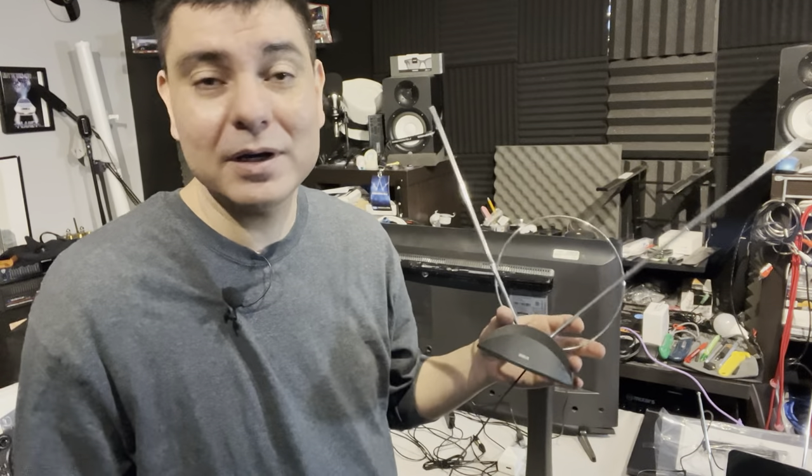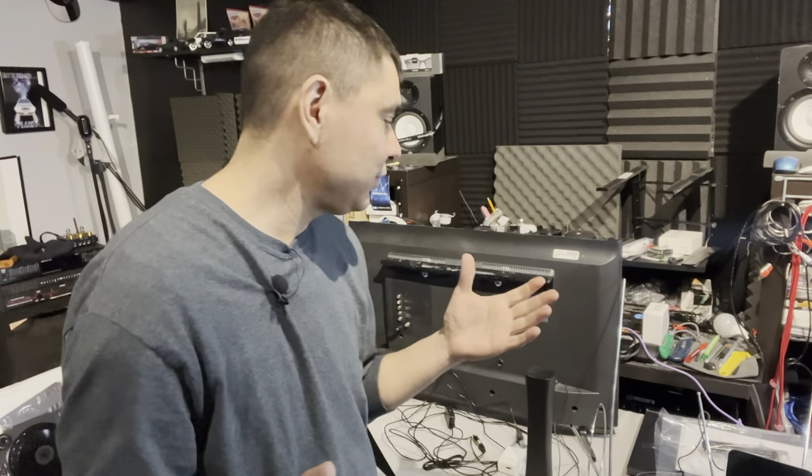From what I found with this 2015 Samsung 32-inch TV, no converter box is needed. All you need to do is hook up an antenna. Most smart TVs and newer TVs from 2015 and up have the built-in ability to process the signal from your antenna, so you don't need to buy anything extra. I did notice some Vizio TVs don't even have an antenna port — I don't know if there's an adapter — but for most TVs you can simply plug in an antenna and get local stations.